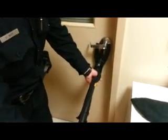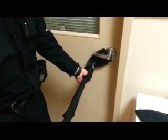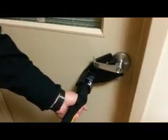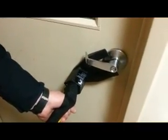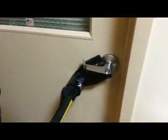He's going to hook that handle, and then he's going to rotate it about 45 degrees. And then once he does so, he's just going to apply some inward pressure to the door itself. And then basically he would take that hand right there, this one, put it back here, and then just pull in towards his body weight, and you would remove the door cylinder.